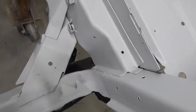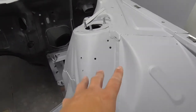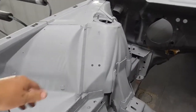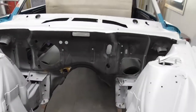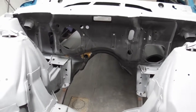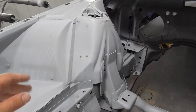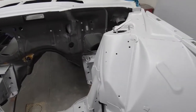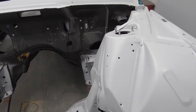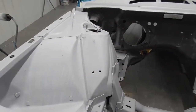Same with this other side here. It's a little bit rougher, but areas out in here are sprayed pretty slick, so it'll sand pretty well out there, and that's where you're going to see it the most. I mean, 90% of all this gets covered up, so does the firewall. But my point is, I'm going to wet sand this instead of dry sanding it, because it's so rough. Wet sanding will be a little easier, and this has a bunch of fingerprints on it, so I can get it nice and clean and not have to worry about fisheye and everything. So let's get to it.